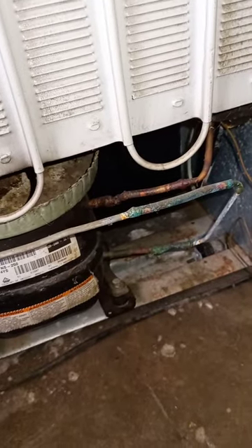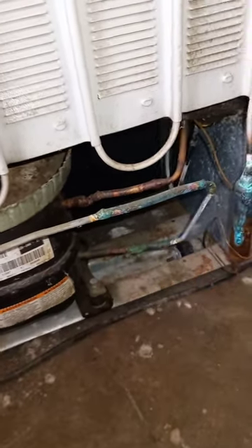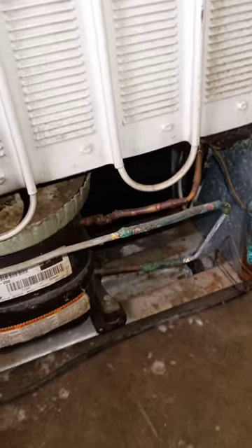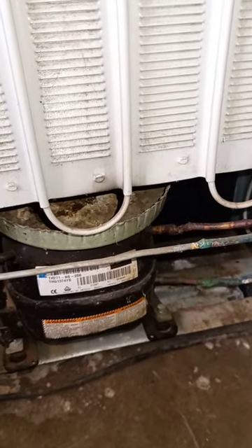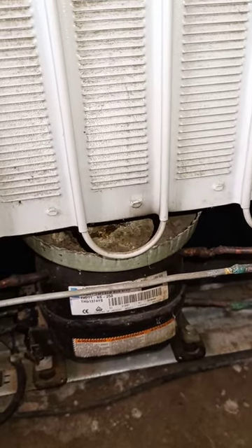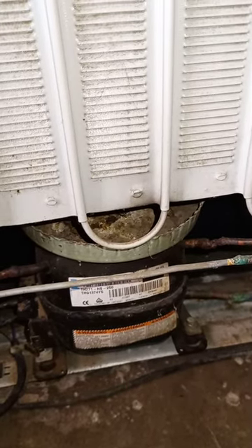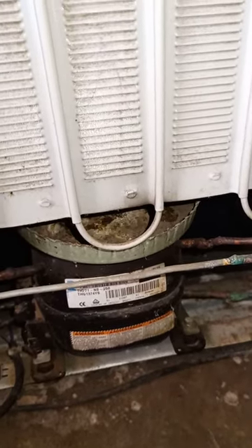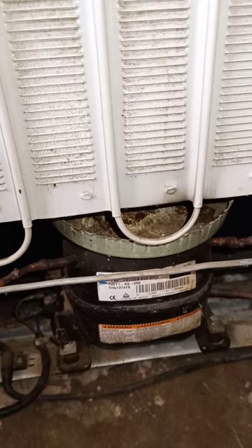By doing that, I know that I am only using the cooling system — because this pipe goes to the evaporator at the fridge, comes down to the freezer, then comes back as the capillary tube. The capillary tube goes to the freezer, not to the fridge, because we want cooling to start at the freezer. So if I vacuum here, I will only be vacuuming the cooling system — the evaporator of the freezer and the evaporator of the fridge. If this fridge manages to stay at minus 30 for 15 minutes without moving on my gauge, then I know the system is not leaking.